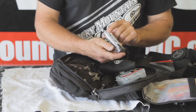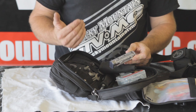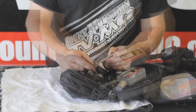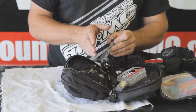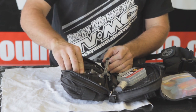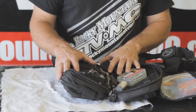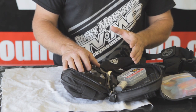In our main section we have quick aluminum — JB Weld type stuff — but this one doesn't require any extra mixing. This would be good if you had a case leak: you could lean it over, clean it off, and it might be able to help you get back to camp. Tusk has a nice bolt kit — this is something if you don't have extra bolts laying around, you can buy something like this; it has a lot of common bolts for most metric bikes. Weight's an issue — you're trying to keep weight down while still bringing enough tools and parts to get you by. Motion Pro has a nice set of lightweight wrenches — 8, 10, 12, 14 — all the wrenches you need, plus a little 17 for getting the bowl off a carburetor. Motion Pro also has a real nice little tool for getting to the pilot jet — good for somebody with a clogged pilot jet. One of the things to remember when packing your tool bag is you could be helping somebody else — if you don't help them, it's going to ruin your day. So if you have the parts with you, you can help get them back, thus prolonging your trail riding day.